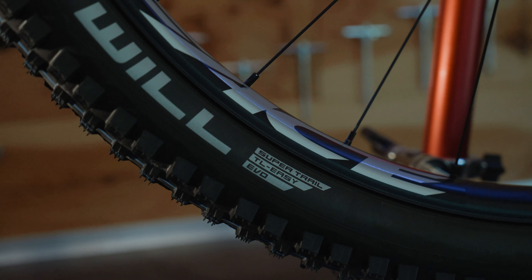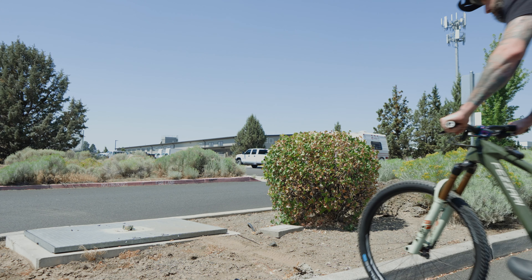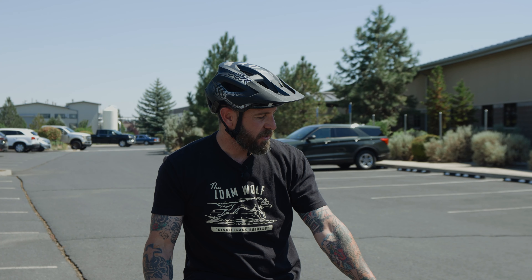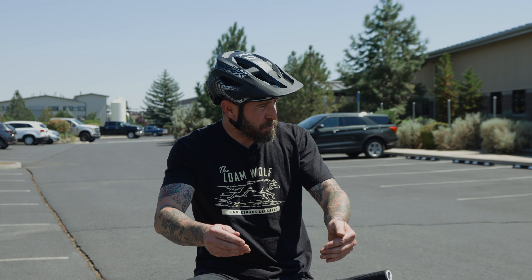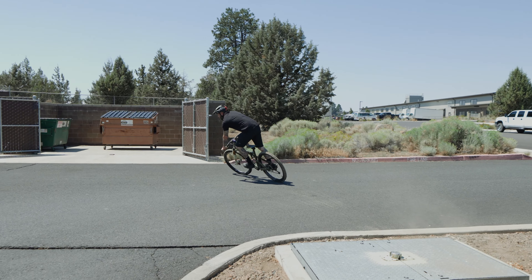Super Trail is similar construction to Super Ground but has the added layer of apex right at the bead area — so a slightly stiffer sidewall, but should perform very similar. Testing Super Trail, I noticed it felt almost more progressive — it went in and then kind of firmed up. That's you feeling the apex when you hit the curb. The apex keeps the tire from deforming as it gets closer to the bead area, so you feel that compression firm up. It almost made me think I'd want to air down a PSI or two to get a softer ride.